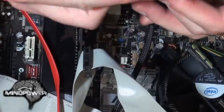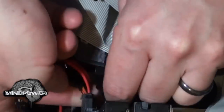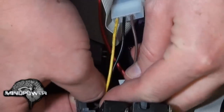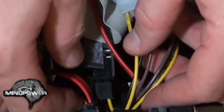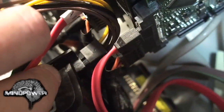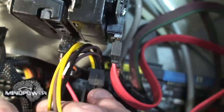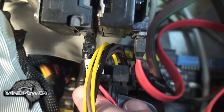There is one last connector I have to plug into this card. It has six pins on it and this is going to plug into one of my power connectors — actually two power connectors. I think this is what they call a rail line. I'll make sure I have a couple of power connectors available for this. There is just enough room to squeeze this power line in for the video card. Here we go — just barely got it in there. The plug is now plugged directly into the back of the video card and it's a really tight fit with the hard drives in here. I literally had to squeeze it right in between the power and SATA plugs on the back of the hard drive.